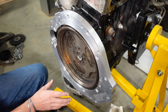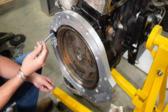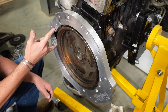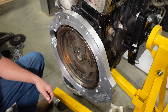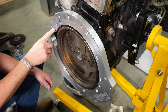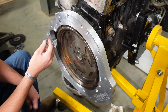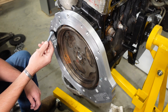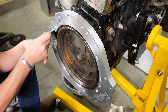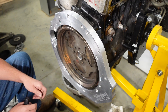The big difference with my adapter kit for the 6-Aught series is how I mount the starter. I've got recessed holes — you can take a bolt, put it in there, and thread into the starter. The problem with this approach is you have to remove the transmission to access the starter bolts. I've designed it so you can mount it this way if you want, but I don't provide hardware for this route since most people won't go that way. If you do, it's a standard M10 socket head cap screw, and I use a 3/8ths washer to fit inside.